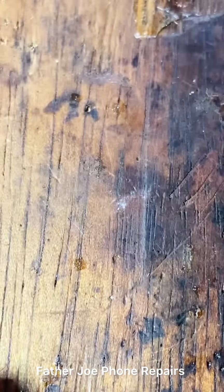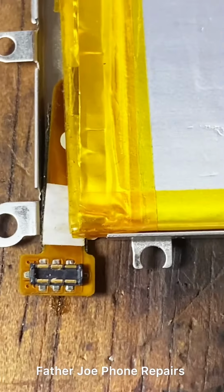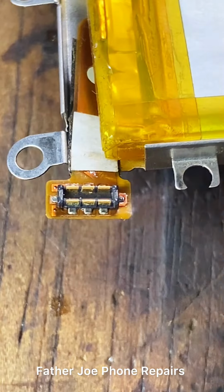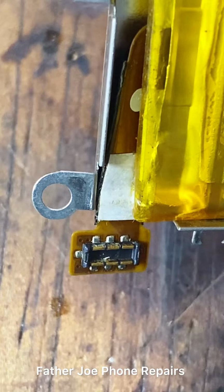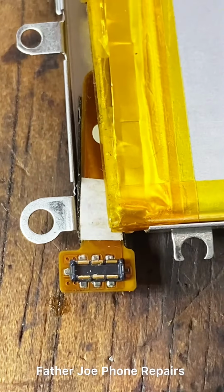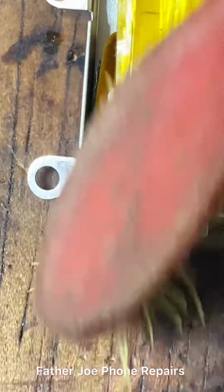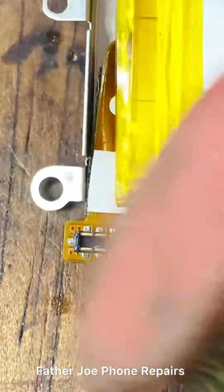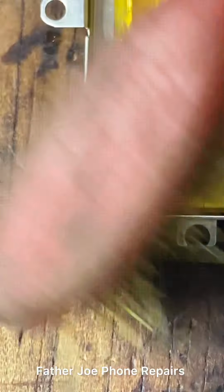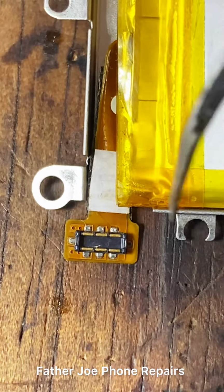After I viewed the panel using my phone camera, I decided to view the battery, especially the battery head, which is this battery BMS connector. Check this out. I view this using my phone camera. I zoom in very well, because I want to be sure nothing is wrong here. So I saw that white thing, and decided to brush it with my brush. I take my time to brush it, because I want that white thing to be out, because that small thing can cause error.